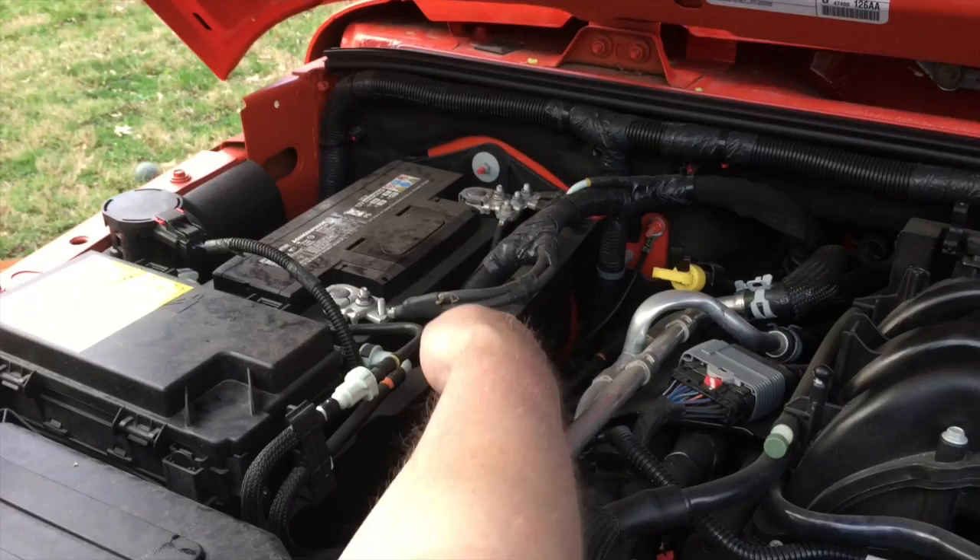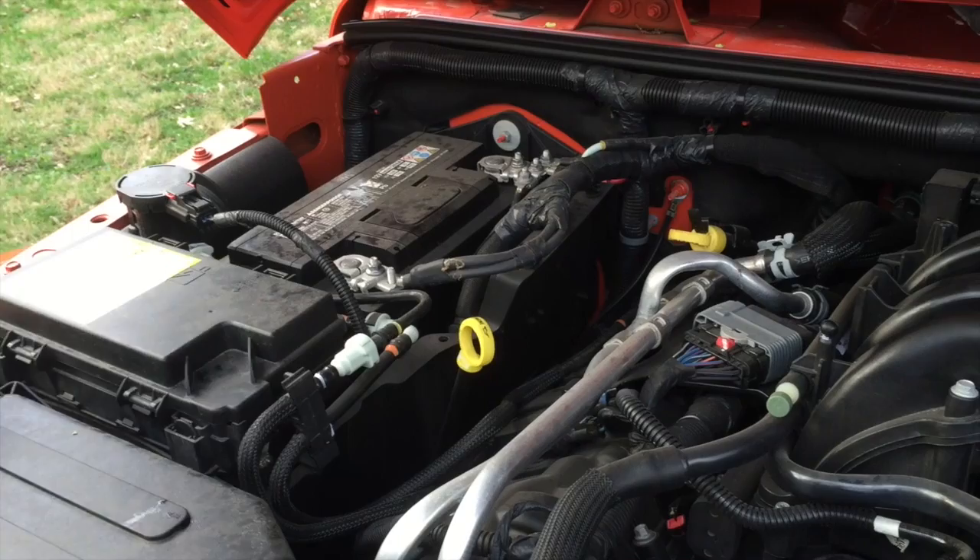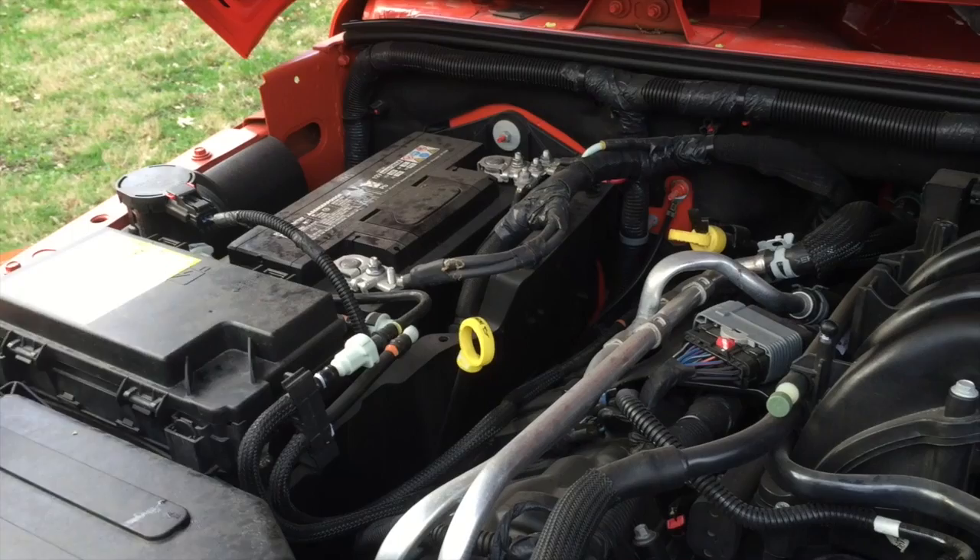I just want to say I'm very pleased with how easy Jeep has made it to change the oil here — it's very clean and very simple. Just with a 13 millimeter and 24 millimeter socket you're able to do this. If I wasn't videoing, I think I could get this done in about five minutes — it's that fast and that easy. I hope this helped you guys out, please leave comments below, thank you.